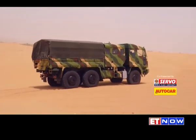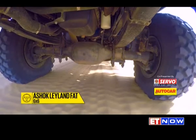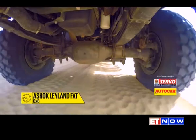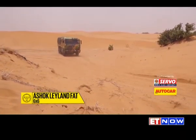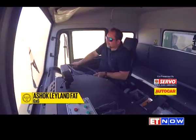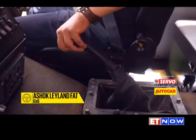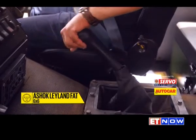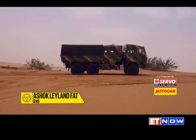Truck engines like this max out at 2500 RPM, and peak power is even lower. This is due to the extremely heavy components and reciprocating masses. So I let it growl to around 1400 RPM, double the clutch, and shift to the next gear. So much for the good stuff, but what about the bad bits?